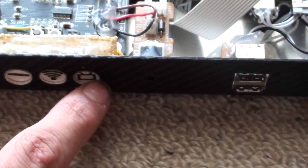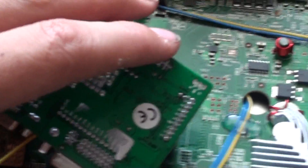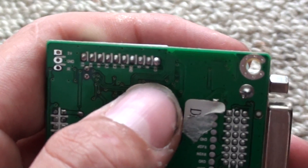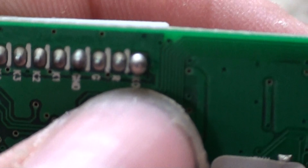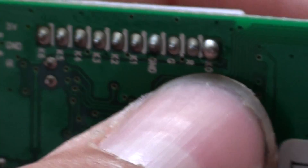And the last one you want to solder — for this button — will be the screen on and off. That will be soldered all the way back here on this pin under the keypad header. I believe it is labeled KO. That should be the off label.